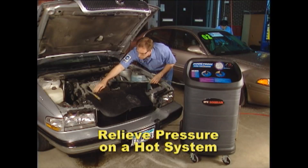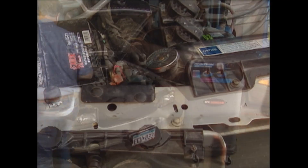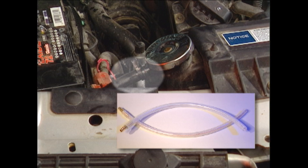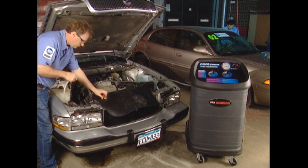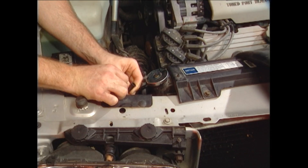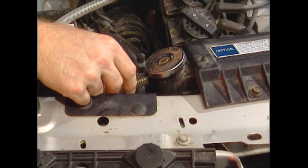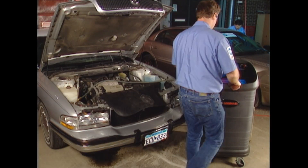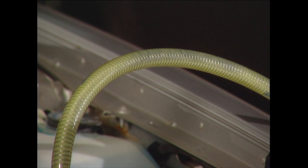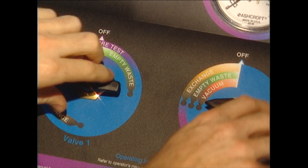On vehicles that have a radiator cap, it is possible to relieve pressure by drawing a vacuum on the overflow port. First, select the siphon tube which most closely matches the size of the coolant overflow barb on the vehicle's radiator neck. Connect the coupler end of the siphon tube to the clear hose from the 75700 unit. Remove the vehicle's overflow tank hose from the coolant overflow barb on the radiator neck. Slide the siphon tube onto the coolant overflow barb. Turn both valves on the unit to vacuum — as the valve in the radiator cap releases pressure, coolant may be seen in the siphon tube. After pressure is relieved, turn both valves off.